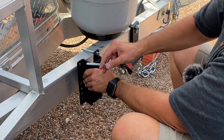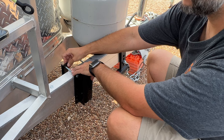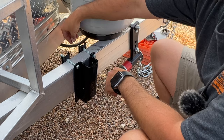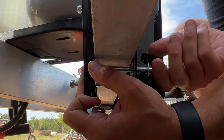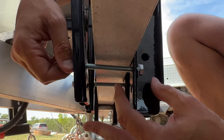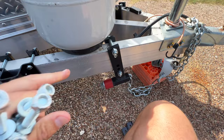I'm just going to put these through here. Plates on the back side — this is supposed to go against the frame rail flat like this. Put my washers on, put my nuts on. These bolts are a little bit longer than they need to be to accommodate wider frame rails. The next available hole is this one — there's no point in going this low. I want to go up as close to the frame as I can. Same thing on this side.